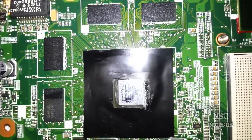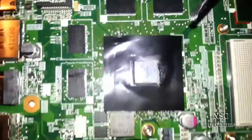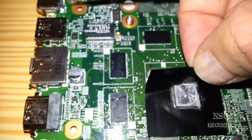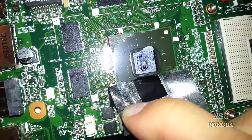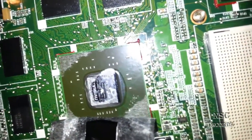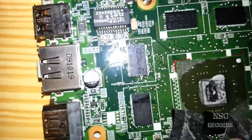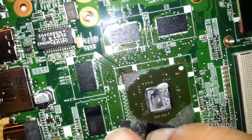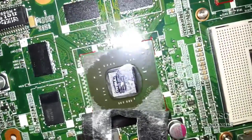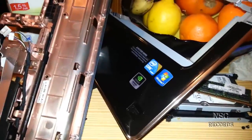You can see it - there is more space on this side than on that side. I've tried to lift this piece up so you guys can see it. It's very interesting and in my eyes it's a bit of a problem. Now you can see this is about one millimeter where the chip was not making perfect contact - so the heatsink was not 100% on the chip, meaning the chip normally gets hotter than it should.